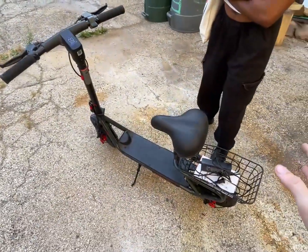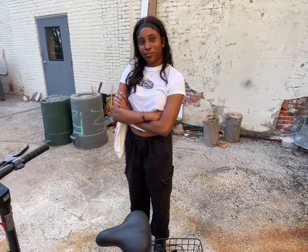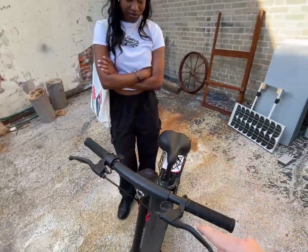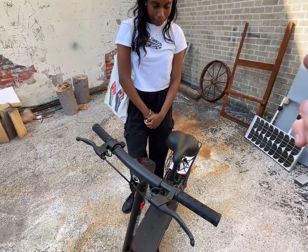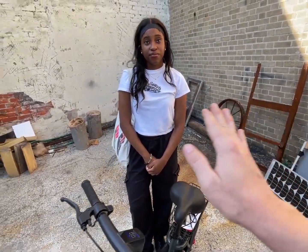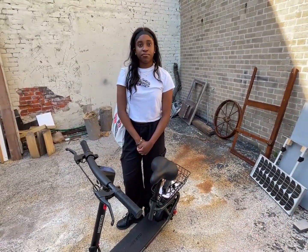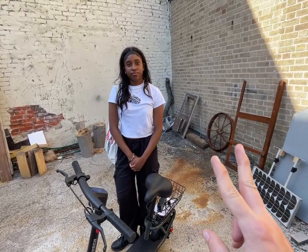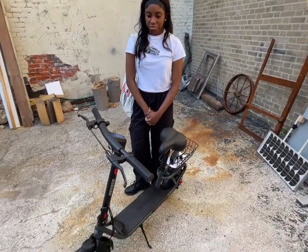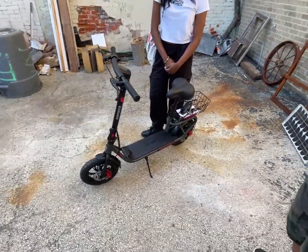We'll let you get going because you're hungry. I came to the workshop and did a little bit but it's just too hot. Be careful on your drive — if the battery runs out, call us and we could help. One nice thing: if you run out of battery, you can still get another two miles after it turns off. If you turn it off and back on and just lightly feather the throttle, you can go about 12 miles per hour. It trips off when the battery dips below a certain voltage, but there's still about two miles worth of electricity left — just go lighter and maybe walk it up some hills. Turn it off and back on for a little extra reserve power.